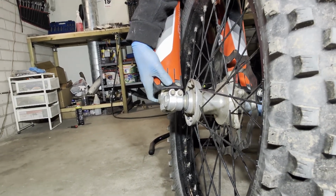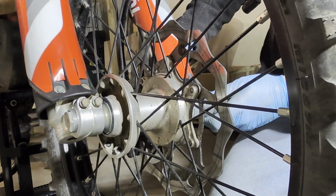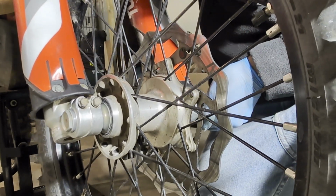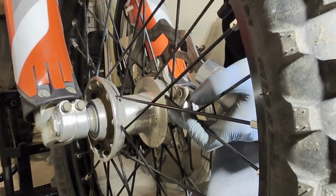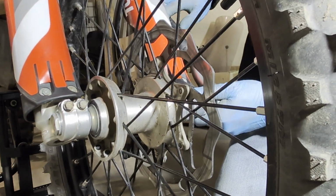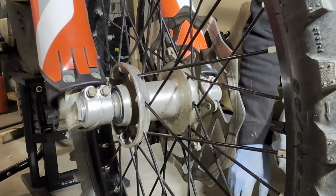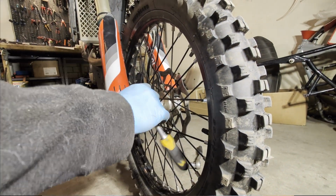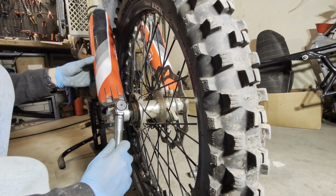For example, it's badly aligned now. And if I turn clockwise from the other side, yeah, the fork adjusts itself. So if it's too far to this side, for example, and if I spin to the other side, it goes back to its perfect position. So now when the forks are perfectly aligned, you can snug the bolts. And you can torque them to 10 Newton meters.